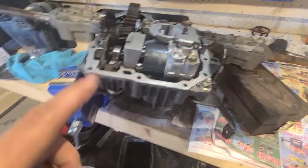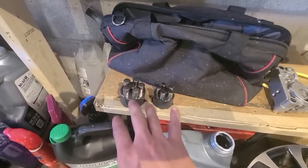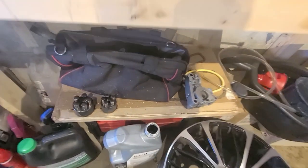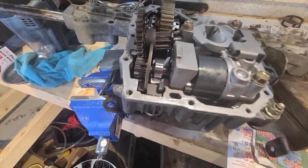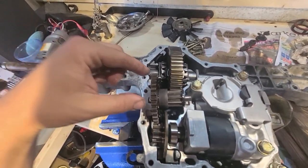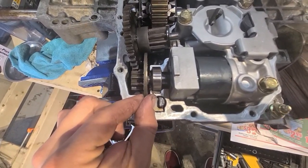But basically it was these three parts that get replaced. One of these is the pump, one of these is called the motor, and this is the center case. So these three things get replaced when you rebuild it. The rest of what's in here is basically just the differential gears. And then there's just this gear that comes down to the brake. The brake is internal on this.